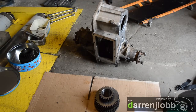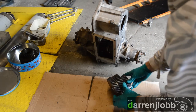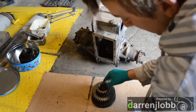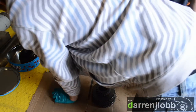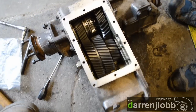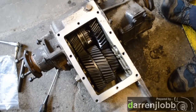Got the unit back on the floor now. These are the intermediate gears that are going to go in the centre of the transfer box — these are obviously new as well, one solid lump. We need to fit the circlips to hold the bearing races in, and then press in the inner bearing races. Those bearings then sit on the intermediate shaft, which we've fitted a new O-ring to, and also the O-ring in the end of the casing. There we go — the intermediate gears are back in now. You can see the new ones there in the centre and the new one on the diff, and it's all spinning freely.